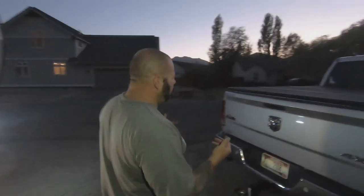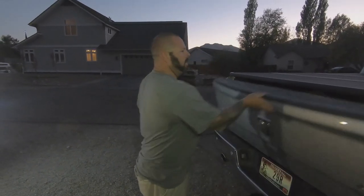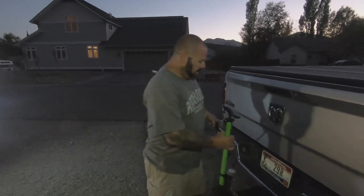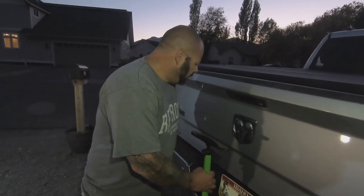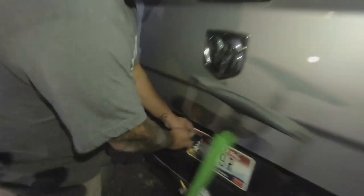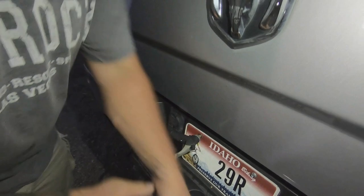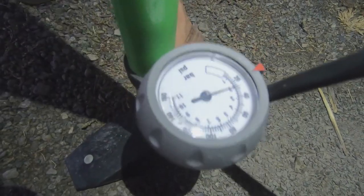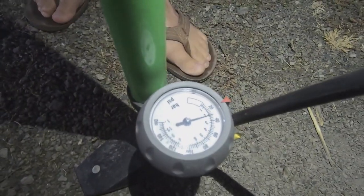The first thing we do — I actually have airbags on my truck. This is a half-ton, and due to the fact that it's a half-ton it's coil springs only; it doesn't have leaf springs or anything else, so when you hook up it sags quite a bit. We installed air shocks on our truck. I've got an air pump — I don't have an air compressor out here — and I like to run about 30 PSI; that seems to be the magic number for me. All right, as you can see I'm at 30 PSI now.